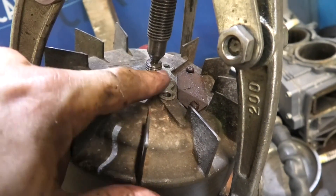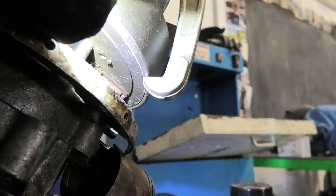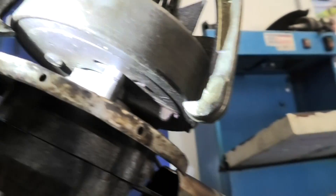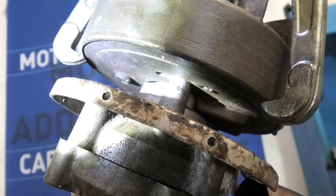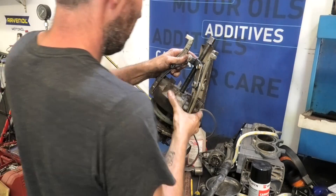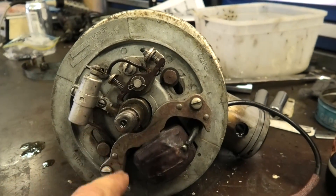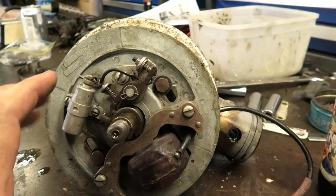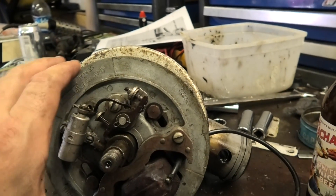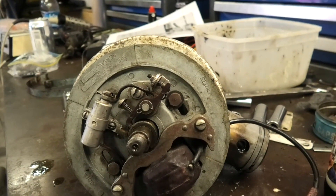I couldn't get a flywheel style puller into these threaded holes, so I'm using this hook style. I'm going to have to put them right on the edge here so that they don't catch the base plate, and they just pull the cover up. Once it starts moving we should be fine. We'll get this back to the bench and get this apart. You can see the plate that mounts the ignition system is slotted so the plate can be rotated to advance or retard the ignition. The flywheel turns clockwise and this is turned clockwise fully, so it looks like it's in the fully retarded position at the moment. Then you've got a little adjustment here for your points gap and a little condenser. Let's get this off.